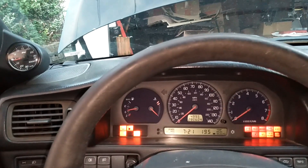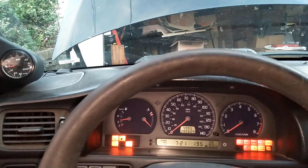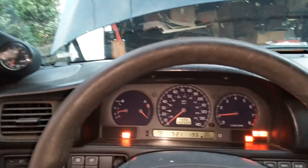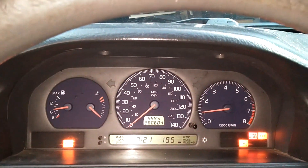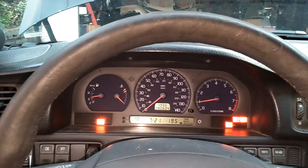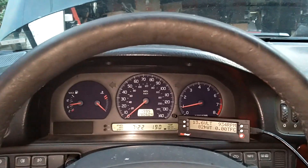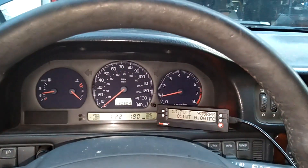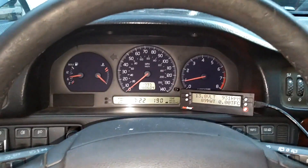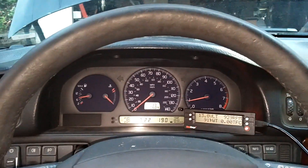Let me fire this car up and see if it starts. I heard the fuel pump running for a few seconds — didn't hear it that second time. There it goes. It fired up and is taking a second to stabilize. Still got an ETS light — I may need to clear that. I scanned for codes and didn't get any on the scan gauge, so I did a pending code check which showed nothing. I did a force clear and it cleared the ETS light. We'll see if that comes back — it normally stays away while I drive, but it's come back after a full duty cycle when I shut the car off and restart it.